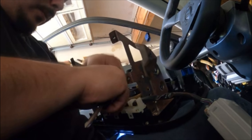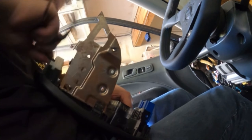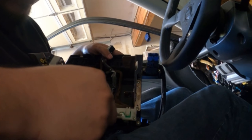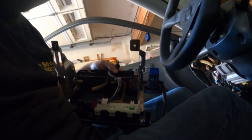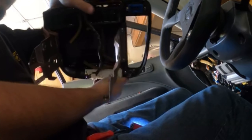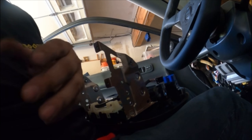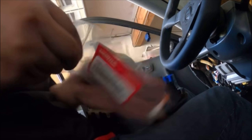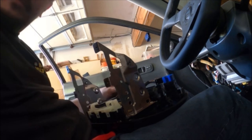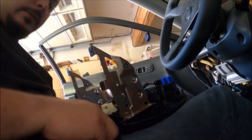The other two bulbs we're replacing are right here, so we can disconnect this little harness — let's get that out of the way. Now we have access to these bulbs. I'm going to need a little flathead — I have one here. I'll remove these two. Those are going to be our long bulbs, so let's get our parts. That's going to be your part number right there — drop that bulb in. Got our other long bulb, drop it in there.